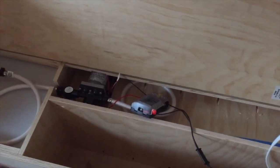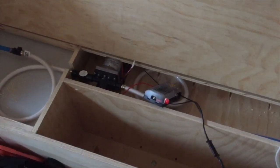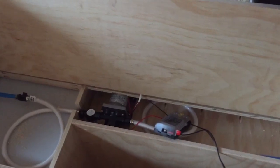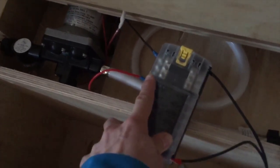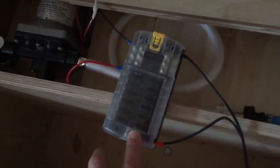This is the part I've been looking forward to. In order to proceed to the tiling of the bathroom, we need to check the water, because if water comes out behind the tiles once they're put in, there's no turning back. I have my tank half full with water and a really temporary system hooked up to the pump. The reason it's temporary is because I haven't wired up the batteries yet — that side of the van is still a bit raw. What we have is our Blue Sea fuse box with our pump wired straight to it, using a little 15 amp fuse, with a positive and negative wire going to where the battery would hook up. This wire came with a car charging kit so I just put that straight on.